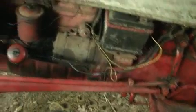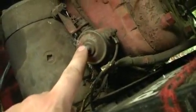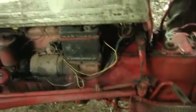Because the starter spins faster, you have to wait for it to fully stop spinning before engaging it again, otherwise you'll grind the teeth off your starter gear. I wouldn't recommend pushing the button while it's still spinning — I got it stuck one time and the switch just kept trying to start the engine while it was already running. That can burn up your whole system, short out your battery, tear up your gear, and do a lot of damage.